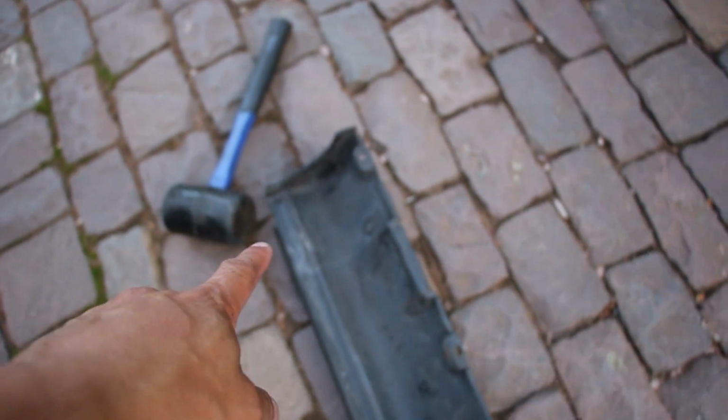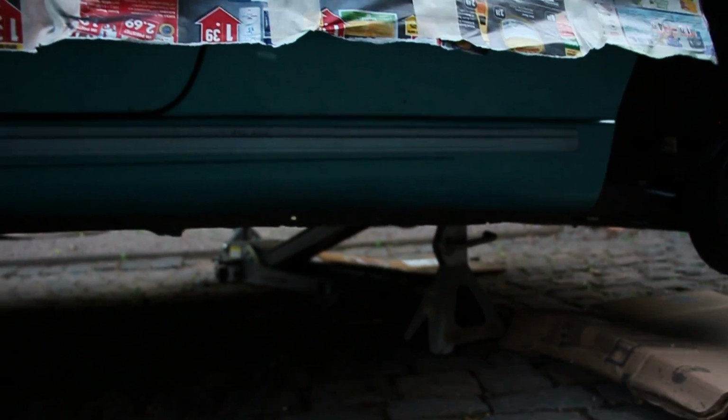Got the mounting strip secured to the car, so now all we need to do is basically just set this right on top. There's a little notch right here that slides right into the corresponding gap right there, and it pretty much just sits on, and then I use the zip tie on the front, hook it to the corner, and on the back side, and then the little holes in the bottom section as well, I always zip tie it on just in case it ever falls off. At least it won't go too far, hopefully.